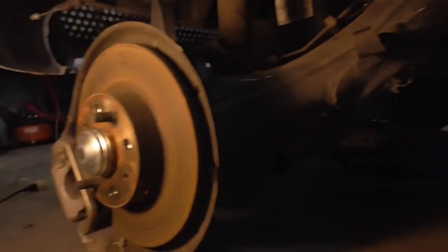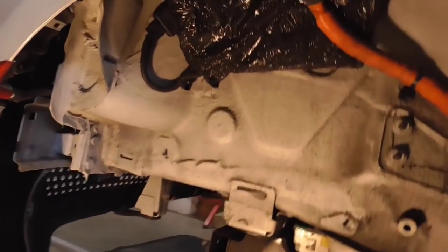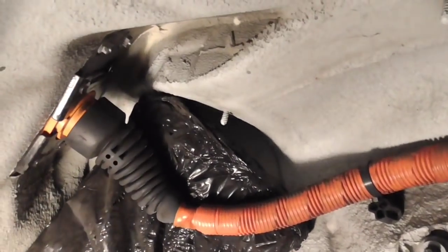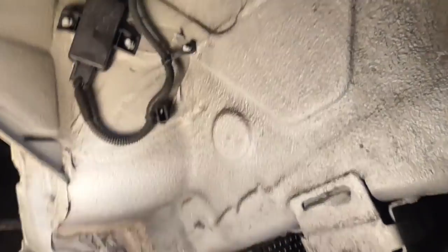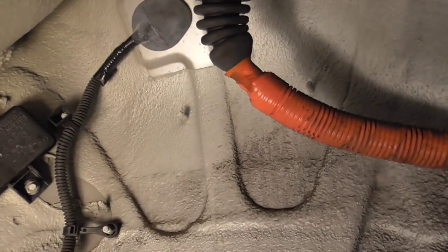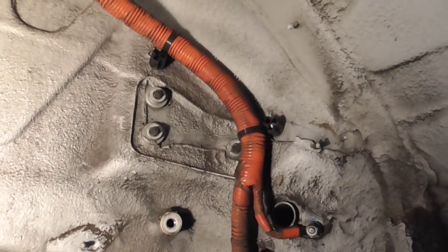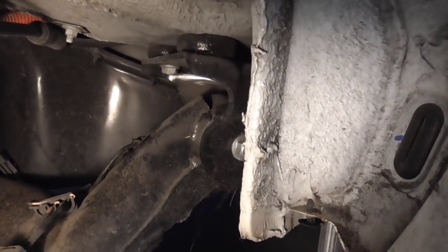While that's happening, I'm over here — I took off the inner liner of the back here. This is going to give us access to wiring mostly, and then to our charge port which is right here. There's a piece of fiberglass insulation in a plastic bag wedged up underneath the plastic liner. We've got some nice cabling right there that we're going to extract out. As far as taking the axle off, there are a couple of ways to do it — there are two bolts that bolt the swing arm to the pivots on the chassis, but there are also three bolts attached to the whole bracket itself.